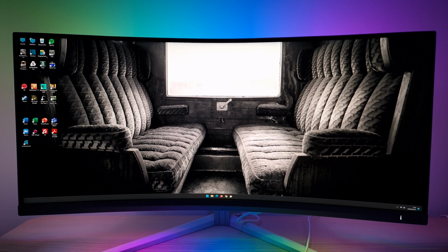I think it did well on the colour side under HDR, decent DCI-P3 coverage, and actually some extension beyond that, some encroachment onto Rec 2020, particularly for the red to blue edge of the gamut. Allowed a good level of vibrancy where the developers wanted it, and good muted look elsewhere, and it was a bit better than the ViewSonic alternative when it came to its HDR colour performance, I felt, as the ViewSonic tended to oversaturate even where it shouldn't.